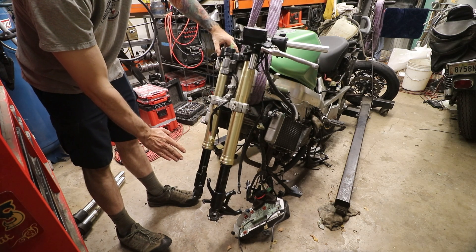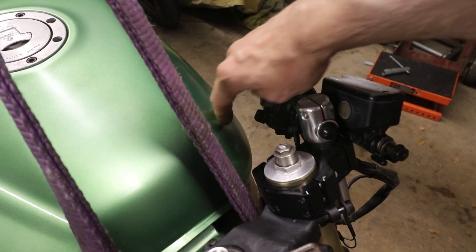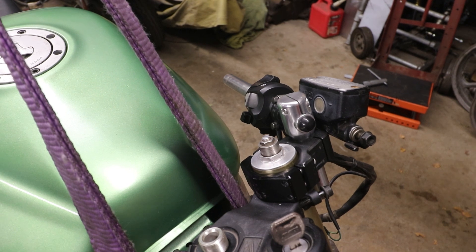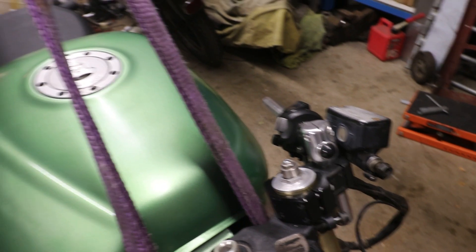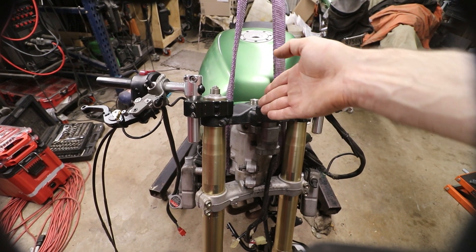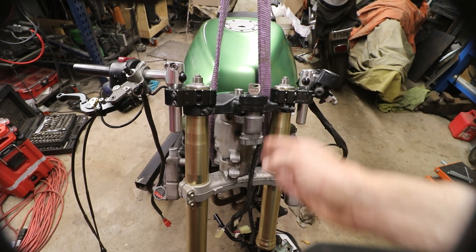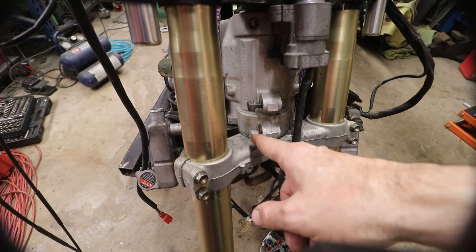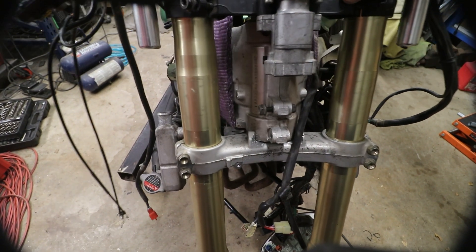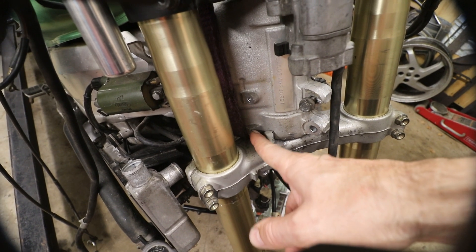This should provide a decent turning radius in terms of where that tire is going to rotate — I feel like that's within the realm of functionality. You can see I've got what I believe is a reasonable gap between the handlebars and the tank. I'm not sure what a stock bike like a CBR looks like from the factory for comparison. In terms of the angle if I tilt the bars all the way to the side, it's very similar to the CB500. My next step is down here — we've got this bump stop coming into contact right up there. Moving it all the way over, I can see we still have a gap before it hits that stop over there.